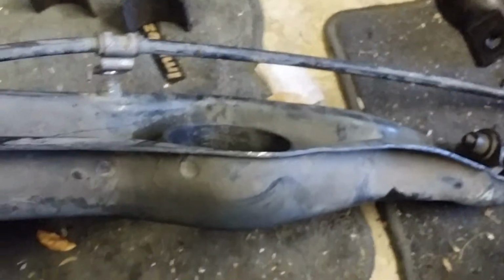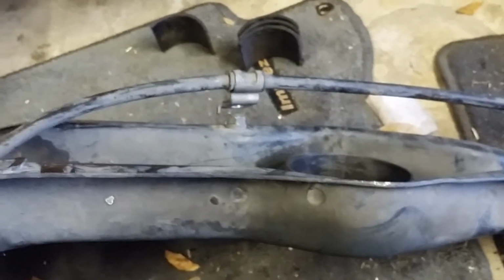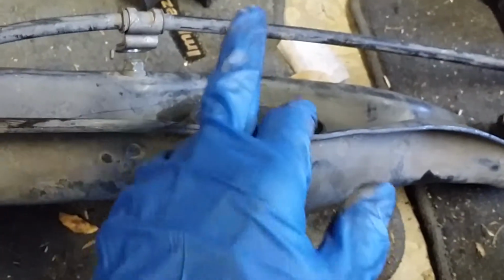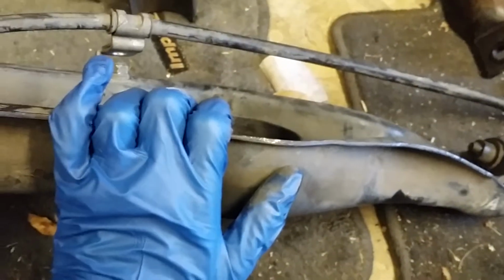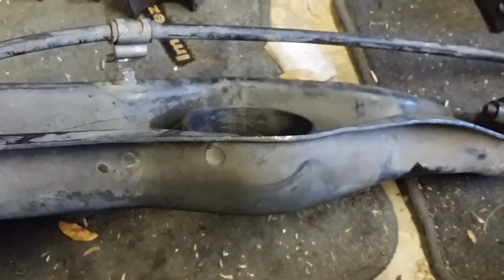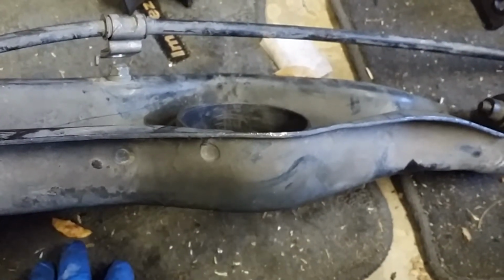So I'm basically almost done. The only thing I need to do, provided that the wheel bearings are fine, the calipers are still fine, is I need to clean these up, grease them up, install them, change out the compensator arms, and then this can go in, and the shocks and everything, and then lower it, put weight on it, and torque everything down.